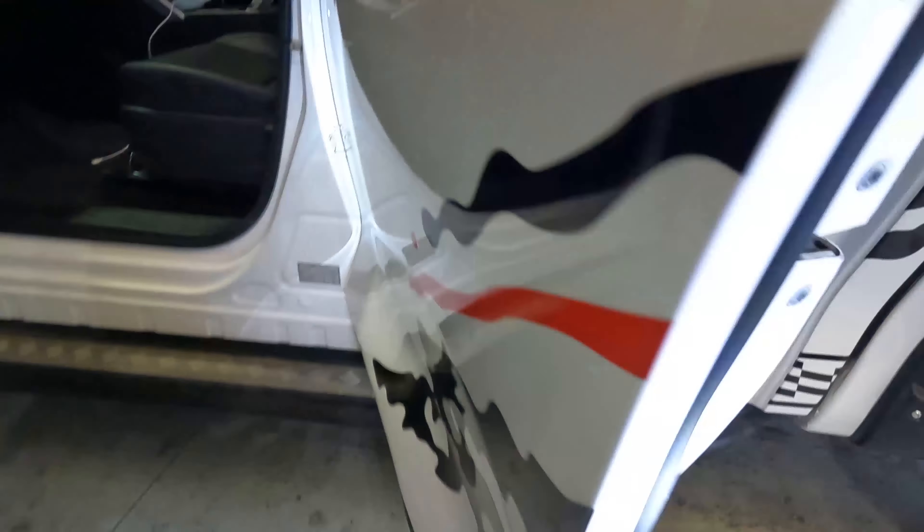Well it's the next day. This is taking way longer than expected. In the process of wiring it up to accessory power, I think I've blown my line output converter because it now has no electricity output. It's down in my kick panel. So this is power in from accessory power and this blue wire is accessory power out to turn on the subwoofers — well for whatever reason that's not working anymore.